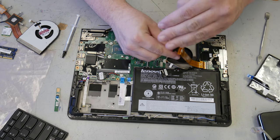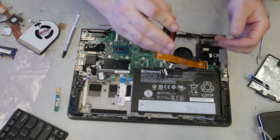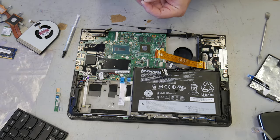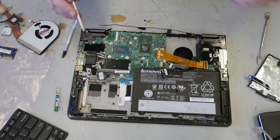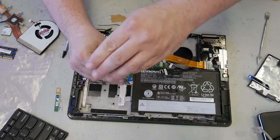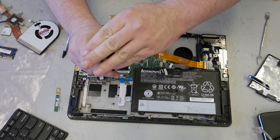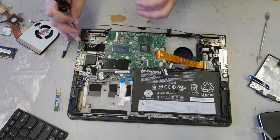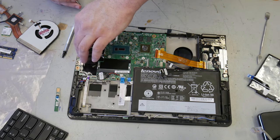If you have a dead hard drive handy, you can tear it apart and rip one of the magnets out of it and stroke it in the same direction, like you're sharpening the screwdriver, about 30 times, and it will magnetize almost any screwdriver, which is how I got these to be magnetic.